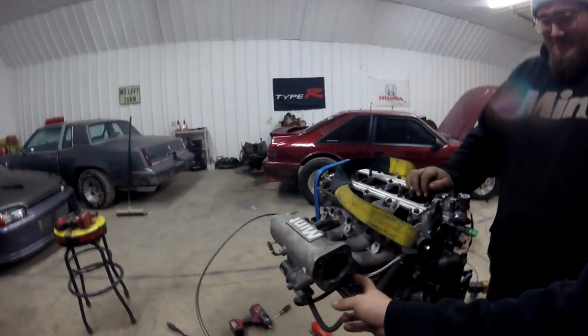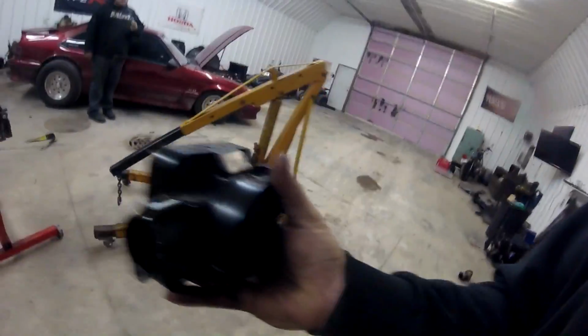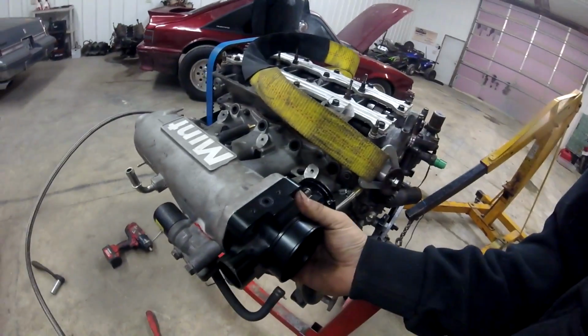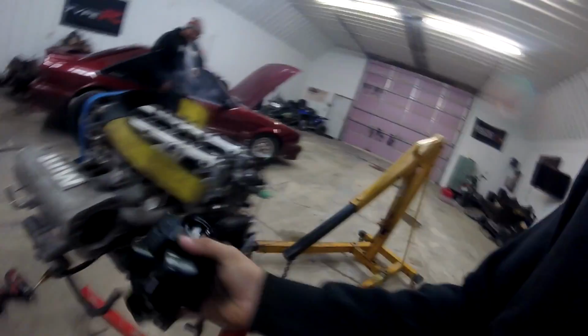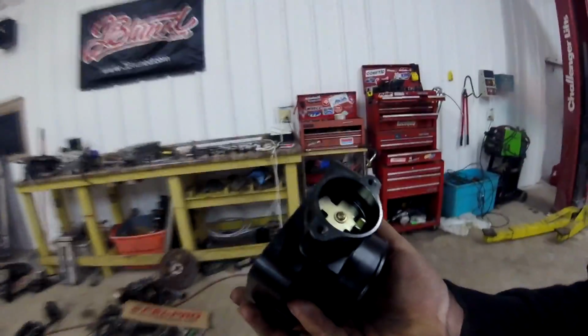So I had a stock throttle body on this, and a subscriber that sent me one of these cylinder heads that I have for parts also sent in this VMS 70mm throttle body. So this is the throttle body that I'm gonna run because it has 70mm, it's a 3-inch outlet. So that's gonna sit on there like that. And I'm probably just gonna get a gasket or RTV a gasket on this thing so we can plug it in there. I can do a lot of this stuff when it's in the car, but I have to somehow get this to go on here, and we have a TPS issue here.